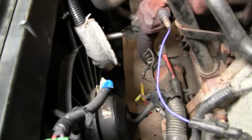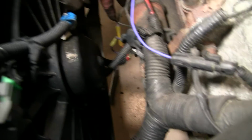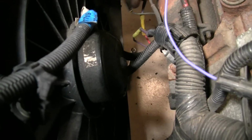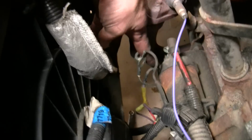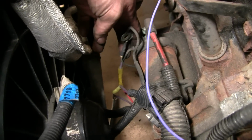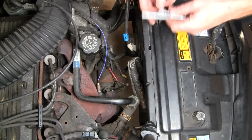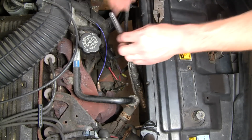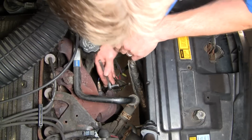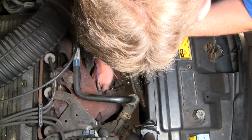And the trouble you can run into when taking these wires off, and you can see somebody ran into it here, there's a splice, because basically when you're trying to remove this nut here, it's all frozen together and the stud is just turning in the solenoid. That appears to be an 8 millimeter nut there on the shaft. So I have an 8 millimeter wrench here, and I'm going to use my 10 millimeter socket and ratchet.